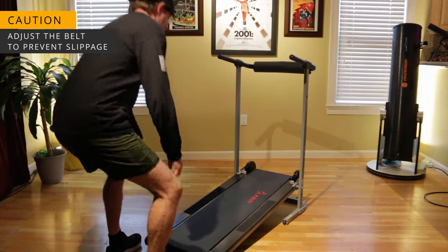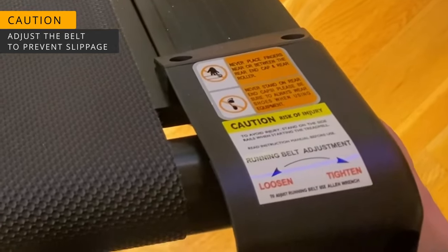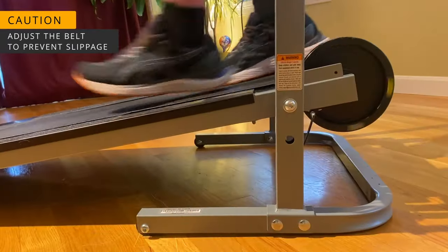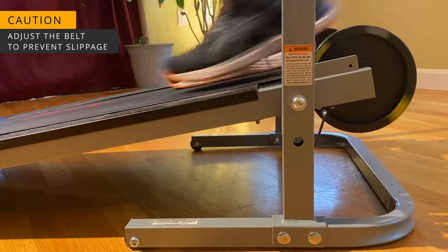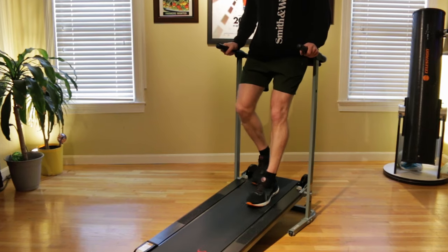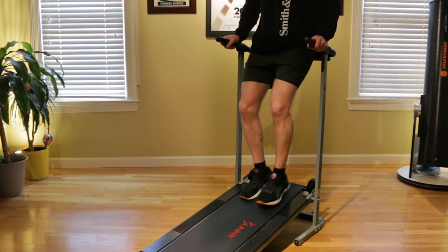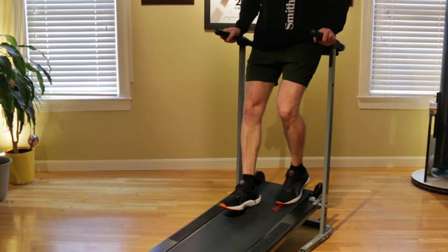To fix this, you need to tighten the belt. It shows you which way to turn the tightening screws, and I recommend half-turn increments until the slippage goes away. The treadmill should run perfectly smooth when properly adjusted. Finally, if you're a super athlete and plan on pushing this thing to the max, you should consider investing in a treadmill designed for walking backwards, like the one sold by ATG. But if you're on a budget and willing to fiddle with the wedges, this system will give your knees a great workout.